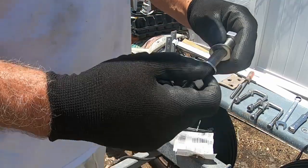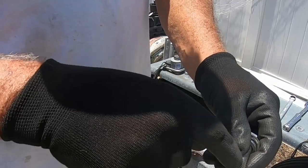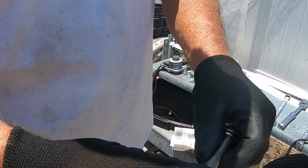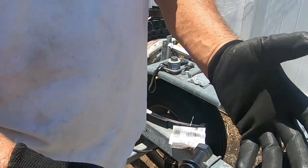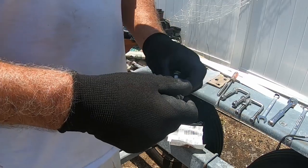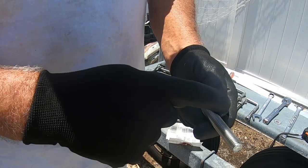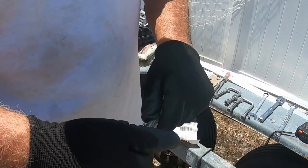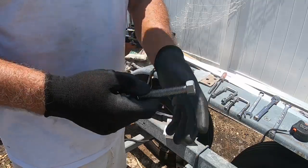But they say specifically, and I actually watched a video on a manufacturer of stainless steel hardware who says, do not use impact tools or anything fast in order to put these things in place, because the heat will actually create a problem with galling. They also recommended that every time you put stainless fasteners together, you put anti-seize on the threads before you put it together, which is interesting because I actually had a similar problem out on the boat lift when I was putting it together and moving stuff around and changing things.